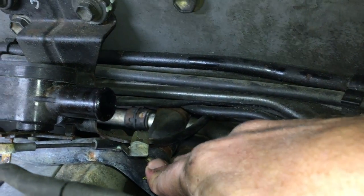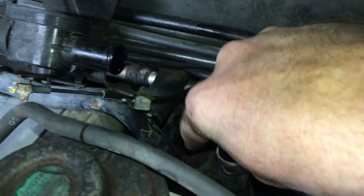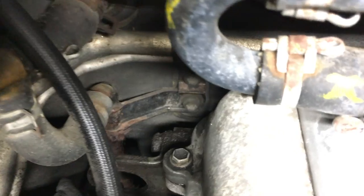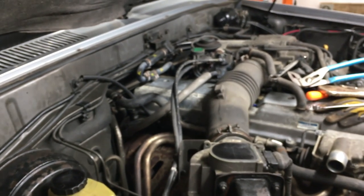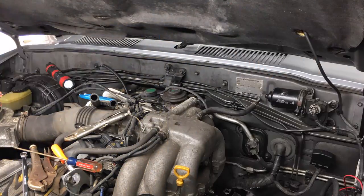This metal pipe here with the X will be eliminated, and so will all this, because I won't need this metal pipe to split off for the front and rear heaters anymore. That lower one branches to the rear. There's a better look at that rusty corroded hard line that goes down the firewall and runs above the transmission — that's one of two lines for rear heat that I'll be bypassing. Should I ever drop the trans, I'll replace and plumb them back in, but those lines are a time bomb when they get this bad. Here's the other rear heater hard line on the opposite side of the engine hiding behind that hook — you can see it's not much better. Do yourself a favor and have a look at those lines because you'd never know they were back there if you weren't looking for them.